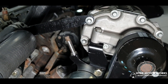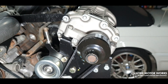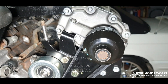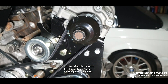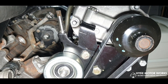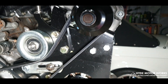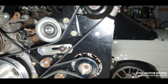Superchargers obviously have lots of different mount points. The next plan is to design a system that can mount onto this base plate system to take the SC14 Toyota supercharger, and after that we'll be looking at mounting Rotrex centrifugal superchargers as well — with only a few additions or removals of these front two little brackets, the base plate system should be able to house relatively easily different styles of superchargers.